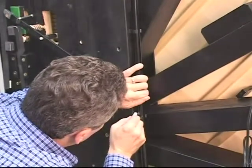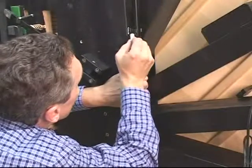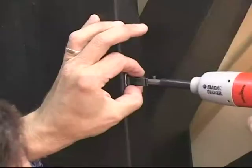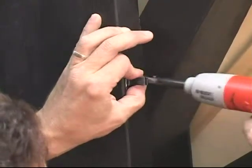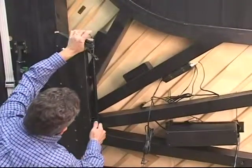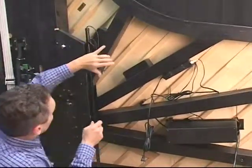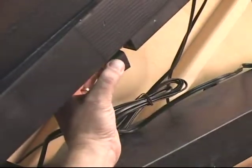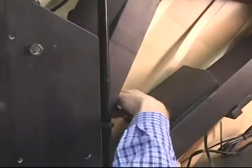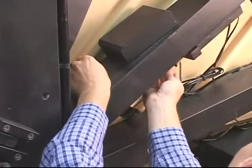With the dehumidifier in place, mark around the clips with chalk. Then, remove the clips from the rod and attach them at the marked points with the half-inch screws. Snap in the dehumidifier so that it is centered in the piano with the cord end closest to the humidistat. Plug the triplex outlet into the humidistat outlet marked dehumidifier and plug the dehumidifier plug into the triplex outlet. Be sure that the triplex outlet is plugged into the humidistat outlet marked dehumidifier.